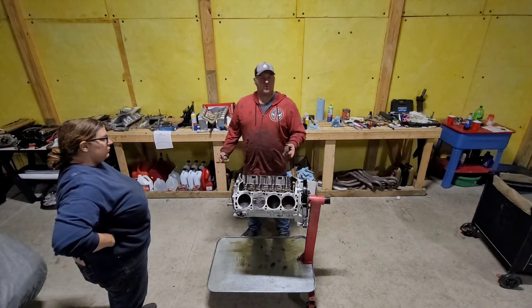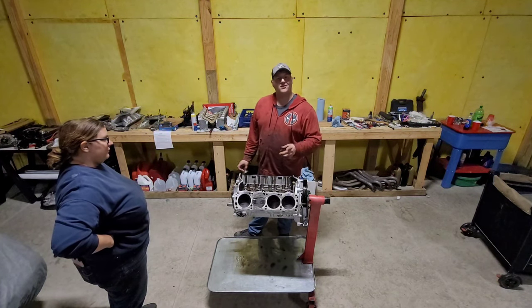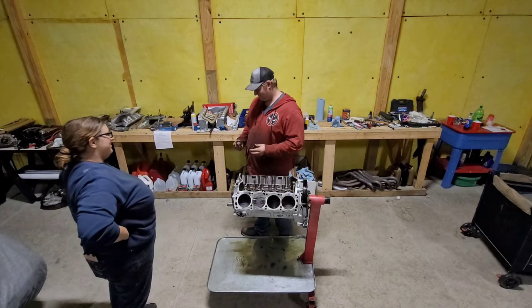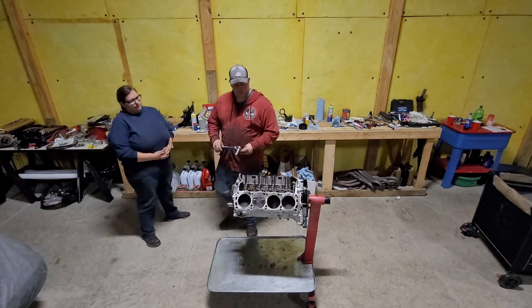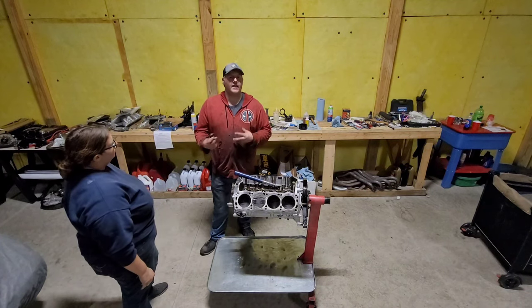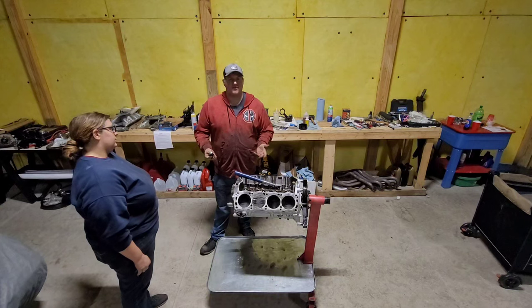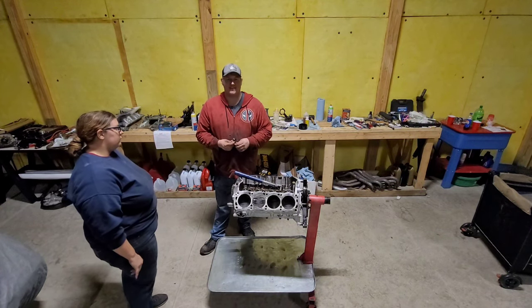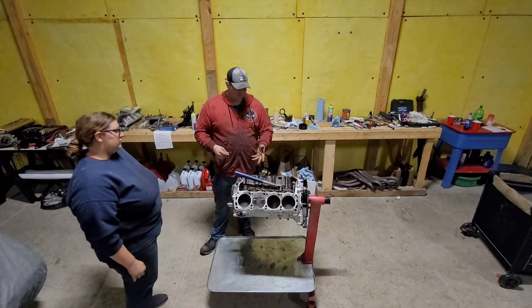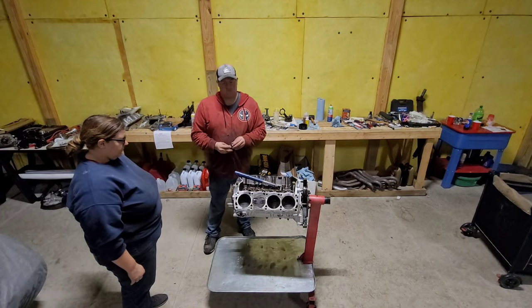So torque spec is 40 to 45. So we're gonna go with the good old 42.5. We are running an electric fuel pump and the timing cover doesn't even have the casting in it for a fuel pump. So not like I'm gonna be able to just slap one on later on if I need it. So we're just gonna run with this guy. Save on that piece over there. Maybe another car we do needs that. Never know.